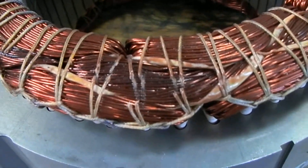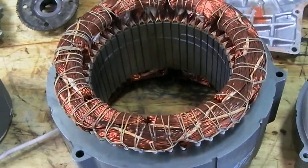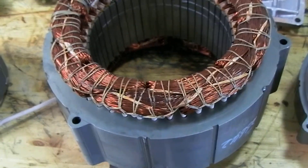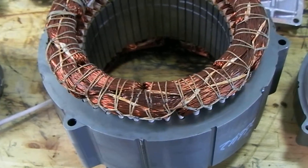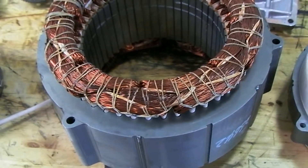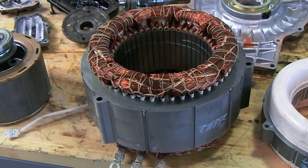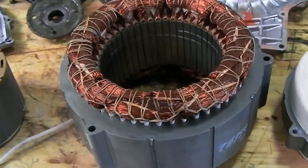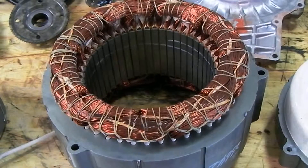That spot that's kind of dark — that's not normal. It doesn't stand out too much; it doesn't stand out like many of the others that have the same problem, but it is definitely an issue. Other than a trouble code, you would diagnose this kind of a condition based on performance. The vehicle will lack power because MG2 is now not able to drive or propel the vehicle like it should.